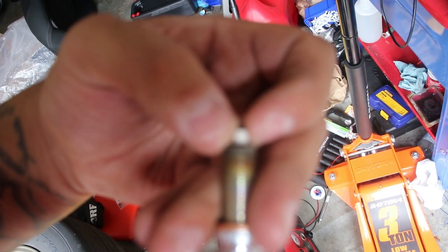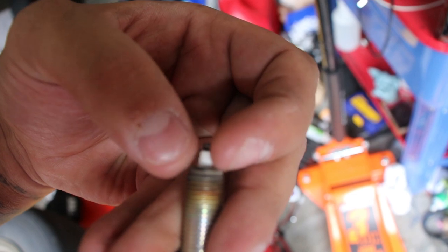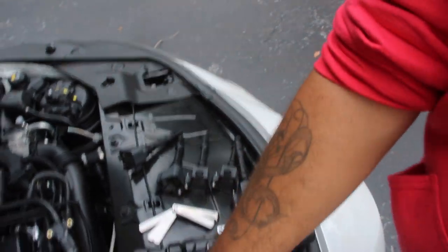That part actually moves — it would cover up the spark plug, so I guess that's what was causing the issue. I had to place an order for a one-step colder plug, so I just put one of the stock ones back in and re-gapped it to 0.020. I'm hoping that helps. The gap will definitely help now that we're starting to get past that 22 psi barrier.